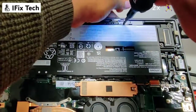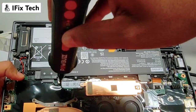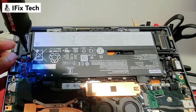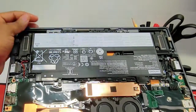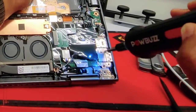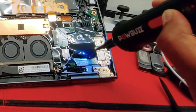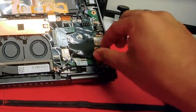All the screws are phillips head screwdriver — they have different sizes and different colors. The battery itself has 6 screws and they are the bigger ones on the whole machine. Once you finish removing all the screws, just pull the battery from the closest side to the board. Now let's remove the USB right port. Take note that the 2 screws closest to the edge are larger than the others. Once done, just pull the port.